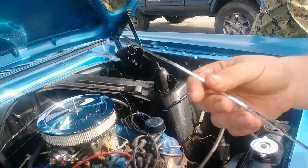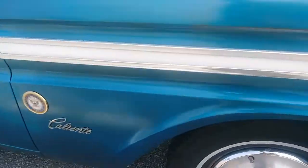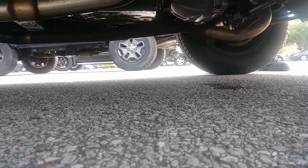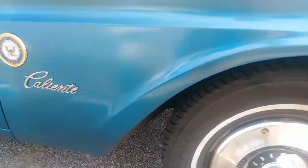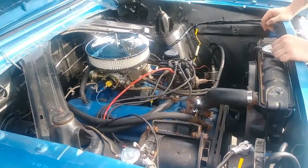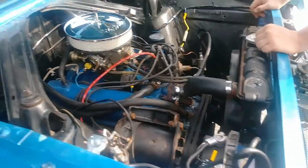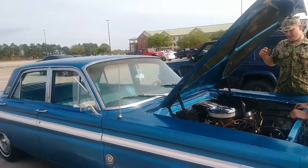It needs to be topped off - it's a little low. How often do you have to top it off? I think it's leaking a little underneath. Oh yeah, there's a rear main leaking. Damn. You said they had the transmission pulled - why didn't they do the rear main seal at the same time? That would have been perfect - another 10-minute job. People make a lot of mistakes like that. They should have said, 'Hey, while I'm there, do you want me to change it?' Now you gotta pull the engine.